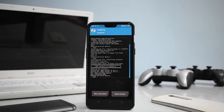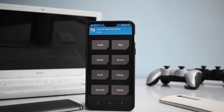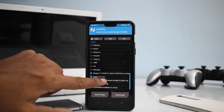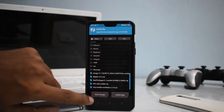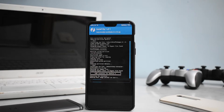Now the next step — if we try to flash Google Apps directly it will give an error due to a compatibility issue with this build. So go to the home screen, go to Reboot and Recovery. Now we've rebooted back to recovery. Go to Install, we won't be wiping anything at this point. Scroll to find the latest GApps and swipe to confirm flash. Then go to the home screen, Install, select TWRP Installer, and swipe to confirm flash. After this installation is complete, we'll wipe cache and then reboot into Lineage OS for our first look.